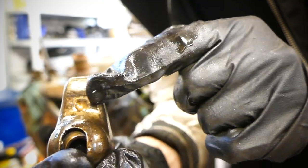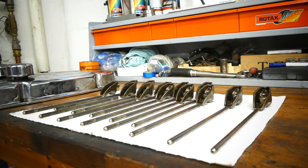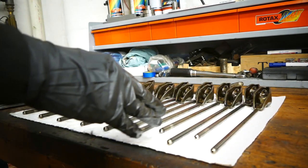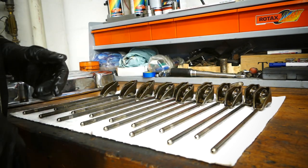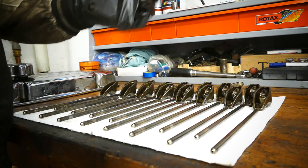That's why we're going to roller rockers, because as you can see it literally wore down right in the middle. We got all the rockers and pushrods removed. I couldn't really see any major damage — everything looked fairly normal — so we're going to dig further into the engine.